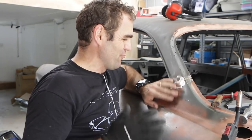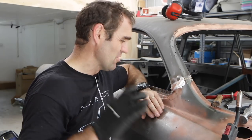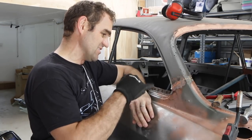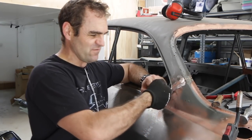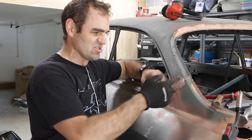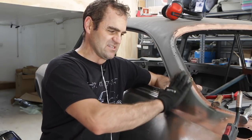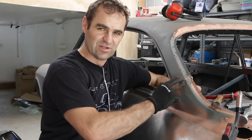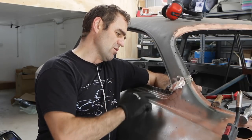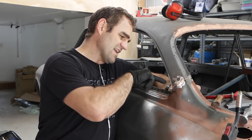I'm really not a fan of that MIG wire. I know it's supposed to be corrosion-free and a good thing, but I just can't seem to get it to weld nicely. So I am going to switch back to regular steel MIG wire and continue. This side is mostly done but I'm struggling with tools — I need to make up some tools to get in and pull out some dents on the inside. I've got a small window to work through but it's difficult to get this as flat as I'd like. There's a little bit of low spots I want to push out, but I still need to weld on the inside, so I'll change the wire back and continue.